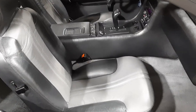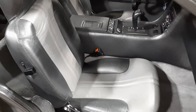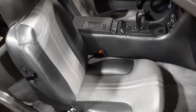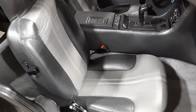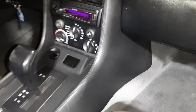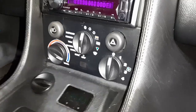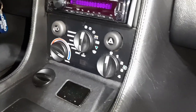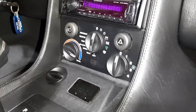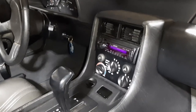Here's one more cool option that DeLorean.com has offered on and off throughout the years — this is a two-tone seat. This is a reproduction seat; the factory never had two-tone seats. Only the leather seats and carpet would be different in color. I'm going to zoom in here and show you — this obviously has an aftermarket Kenwood radio in it. But that's your third faceplate where it's got no decal on it, and all three of those same buttons would illuminate from the back. You can still see the defrost, door locks, and cooling fan fail, but as far as printing on the face of that HVAC panel, there is none.